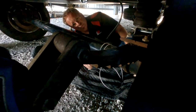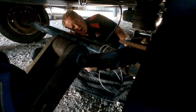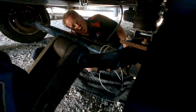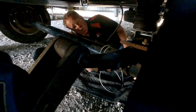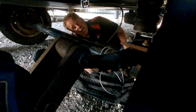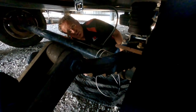With manual adjust brakes, your stopping distances will slowly increase the longer you don't adjust them — it can almost double your stopping distance. So when you buy a trailer, particularly a used one, the first thing to figure out is whether it has manual adjust brakes or self-adjusting. Manual adjusting is not that hard to do — you just have to do it — and a lot of people don't realize that.